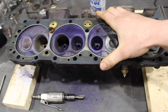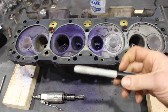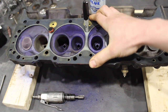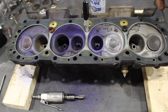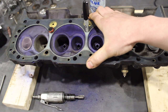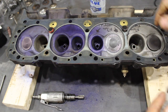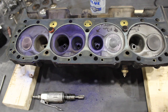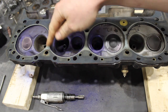A lot of guys will center the head gasket with the bolts, but as you can see, there's quite a bit of movement. Here's a tip and trick: these smaller Sharpies actually fit quite good in the bolt holes — it's a tapered piece. I just found a Sharpie by accident works pretty good. If you have two or three, it's actually better. You can put the bolts in too, or just have two or three Sharpies in there, and then it holds the gasket centered. Then all you got to do is trace out your combustion chamber. Or if you're using machinist dye, you go around and scrape that out with a razor blade or a pick.